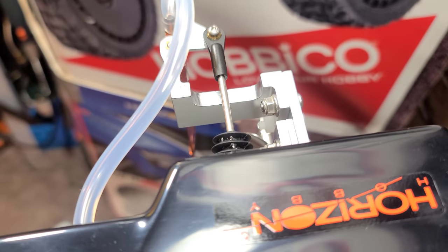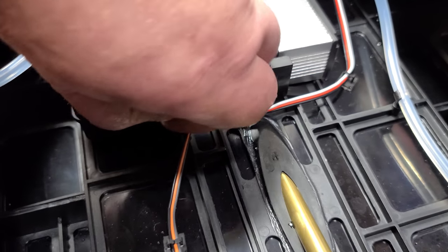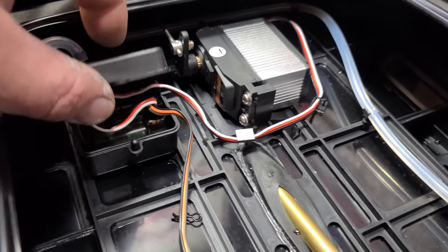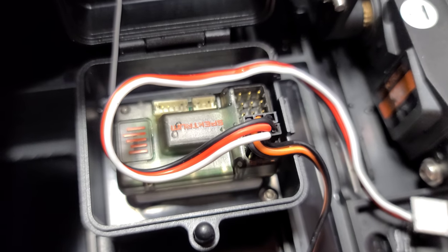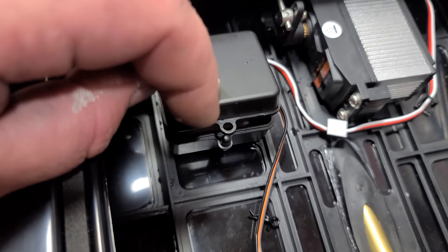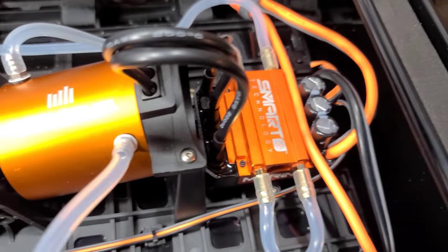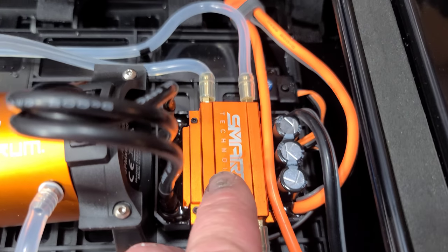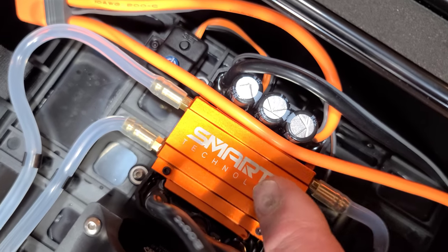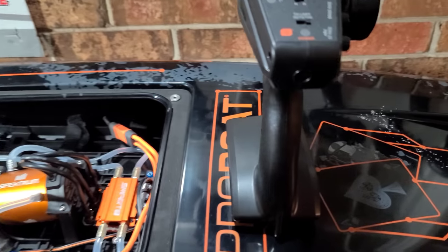Perfect steering geometry to the rudder — very nice to see. You've got your receiver box here with a clip for easy access. It has six channels to expand — you can run lights and all kinds of different accessories off it. Very nice to see they've thought of everything for this price point. You can't beat it. This is a Firma Smart electronic speed controller, 160-amp high-voltage speed control. Look at those giant capacitors on there.